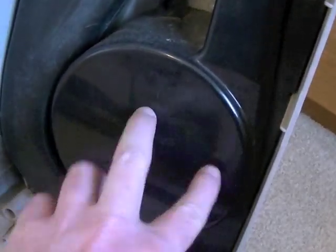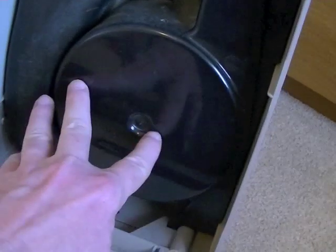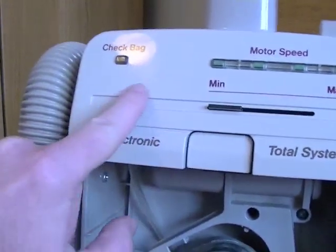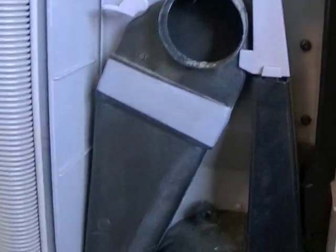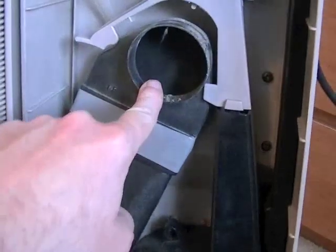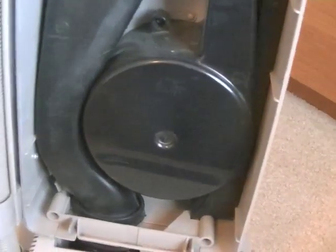You've got the cord reel storage area in there. On this model unfortunately the cord rewind doesn't work — I assume it is fixable but I can't fix it myself. You've got this ducting here with a narrow tube that plugs in, going to the bag-full indicator. The check bag indicator should illuminate red when there's a blockage or the bag's full. There's a lever you can move up to take out the fill tube and dislodge it from the bellows underneath for easier access to unblock. It's quite a wide air path, so unless you let the machine overflow you shouldn't really get a blockage with a Turbomaster.